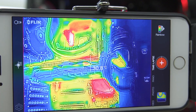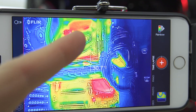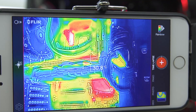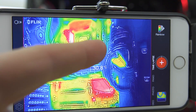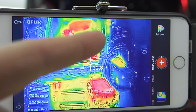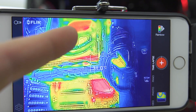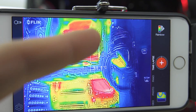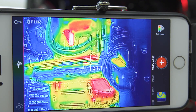I just loaded up an overclock profile here at 5 GHz on the 7700K. And as you can see, immediately the upper VRM heatsink started to get kind of... you can see the temperatures are changing there. It went from kind of a yellow to an orange immediately during booting. What I'm gonna do next is an Aida64 stress test on the CPU and the memory. The bright red area right there is VRM, the top right there is also VRM, and this is chipset. These are the tubes for the H100 that's keeping the system cool. Let's see what happens over time when we put this thing under a little bit of load.